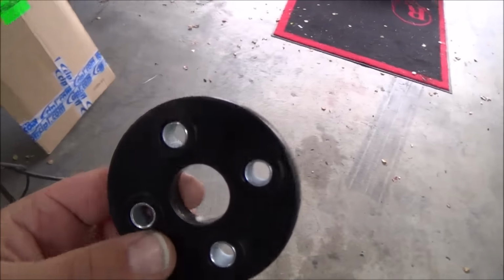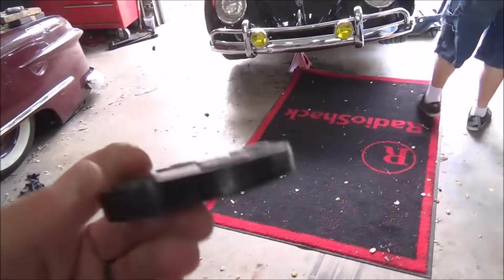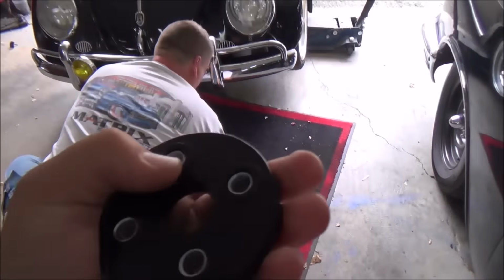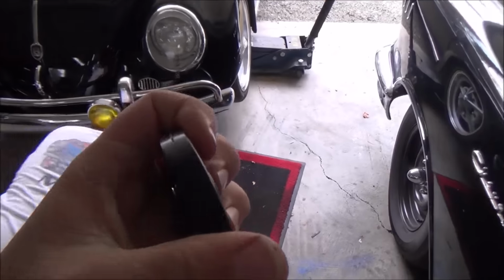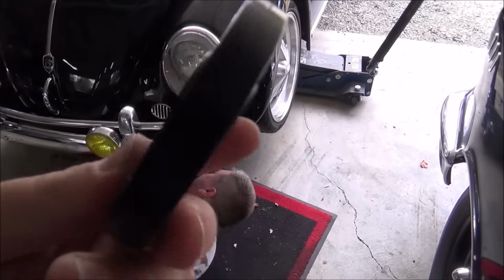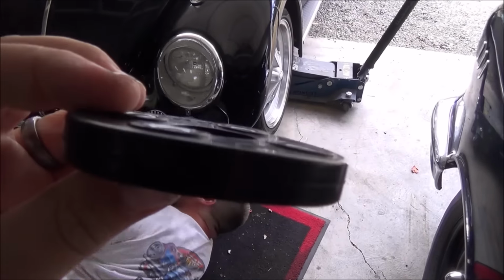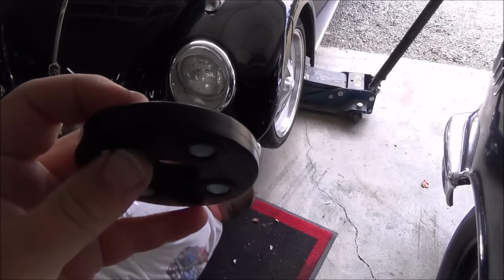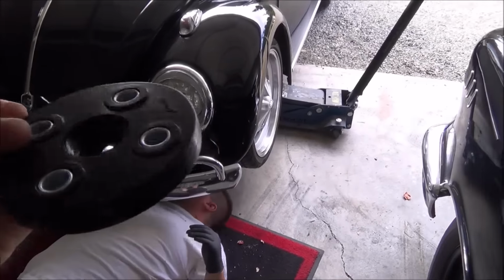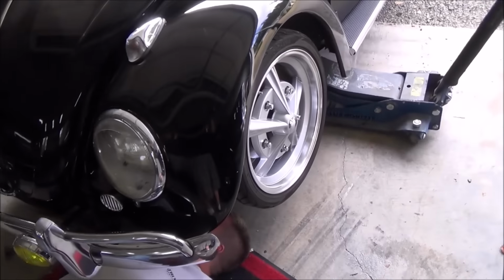Does anybody know, in Volkswagen land, where to get an original style steering coupler? Not these urethane ones. Because this is what's in there, and it's torn. And apparently that's what these do. It doesn't have the fabric inside like a real rag joint. So apparently we'll have to periodically just look at this to see if it's tearing or not. So anyway, that's what's going on here.